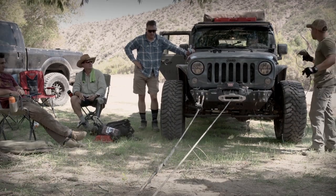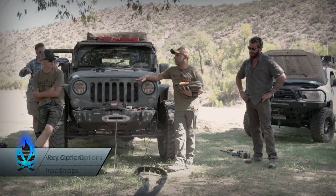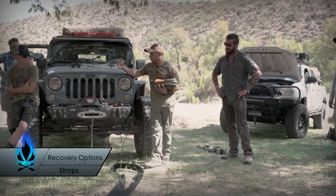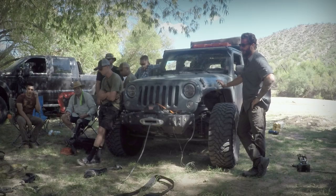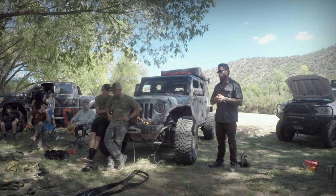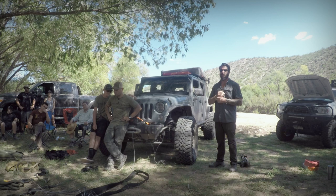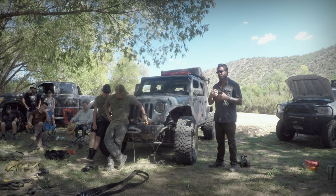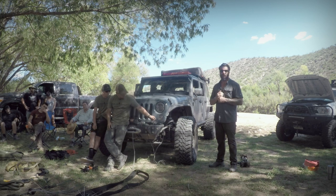Give it a little bit and there it goes — and that's it until you need it where you need it. If you don't have a winch and you need to tug someone out of a hole, here's another synthetic line. Don't forget: dynamic lines stretch and static ones don't. If you're using a steel shackle and that thing separates, it's just like the steel cable story — it becomes a flying projectile and could potentially injure you or someone else standing around. I like all the synthetic stuff; if it fails it doesn't hurt anybody.